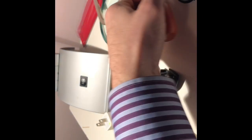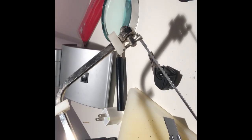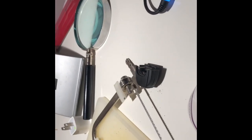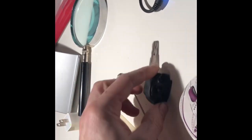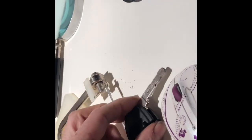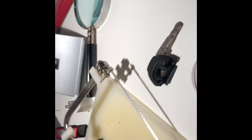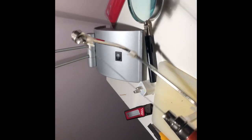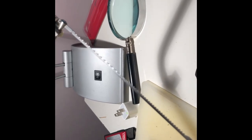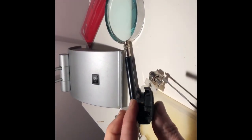Then I remembered that I had a coping saw in the basement. With a coping saw you can actually make some really good progress. A coping saw wouldn't be as good for starting the job off because it would bounce all over, but once you've got a slot made you can make some decent progress with one of these. It's just a wood blade, so I'd probably do better with a blade with more teeth per inch, but it's doing the trick. I've cut it far enough.